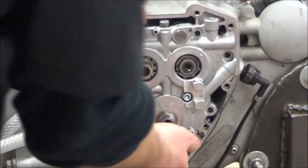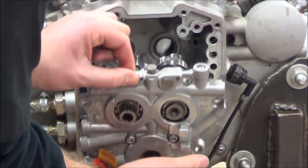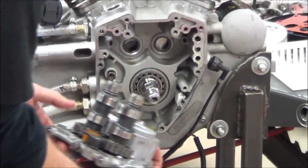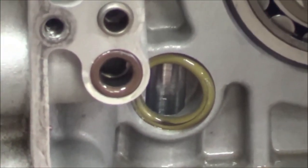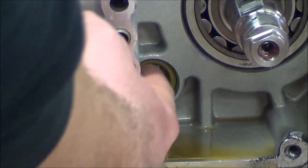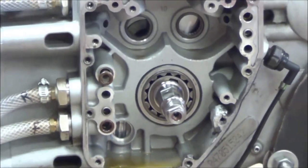I'm going to leave that in there and I'm pulling the whole assembly with the oil pump out together, because we're going to reinstall it. I want you to focus in here on this O-ring — see how it's cocked? That's probably just from removal, and I don't believe it was a problem before. But when we get into assembly, you're going to see where that's really important — that it's fully seated. That is the return for the oil pump, and that is super, super critical. I'm going to take it out right now and put it with the oil pump support plate bolts.